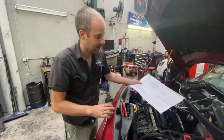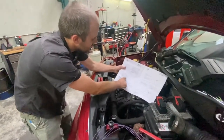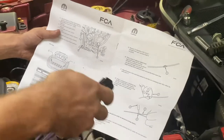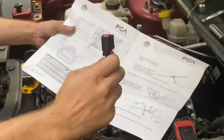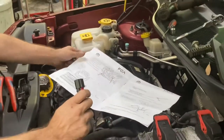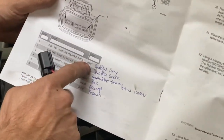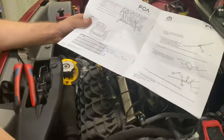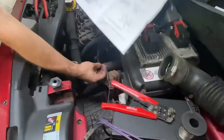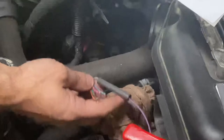Excuse my crude handwriting. The first thing to note is there's a picture here that says 1 to 6 — that is based off looking at that side of the plug, not the back. Using what they give you, pin 1 is listed as DBGY. We're talking about the harness that's with the car. I'll interpret the code for you — this will get you out of trouble. You've just got to solder your little bit of loom on and then plug your new plug on to the existing throttle body, which is all the way down there.